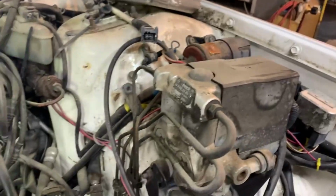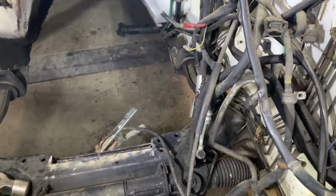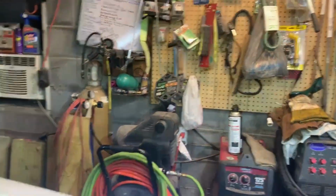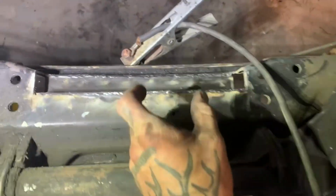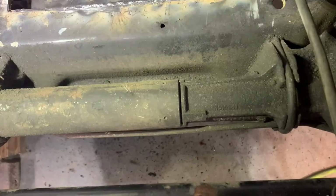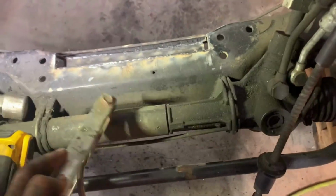But yeah, the only downfall is, I haven't had this one do it, the old Harbor Freight. Once you get running, trying to run a bead for a long period of time, or bubble gum, whatever you want to call it, it really starts to put a strain and it'll trip the breaker on the wall. This one, I've got the AC running, so I try not to run it wide open the whole time. So I'll run a couple inches and then I'll stop, I'll move somewhere else and just move around regardless. But she's all done, ready to roll.